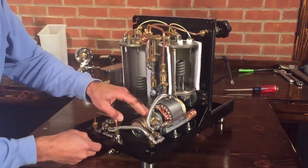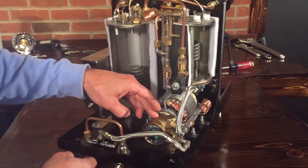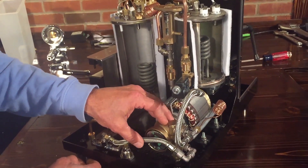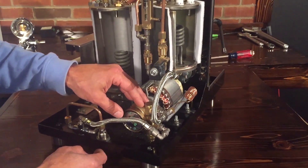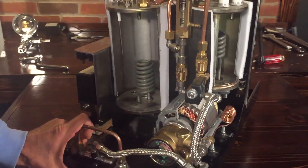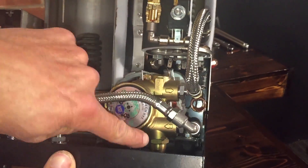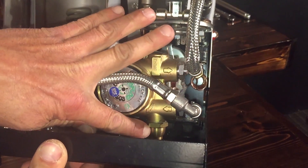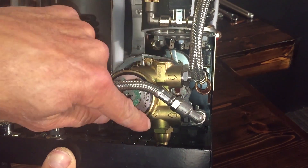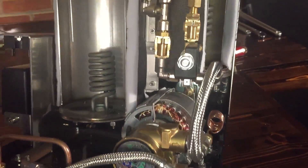You appreciate the inside of this machine, and you've seen just about every machine that's been made. The water comes out of that side. When you adjust the pump pressure, it adjusts the spring in there. If you want to lower the pressure, you can loosen this — it bypasses water around so only a set amount will come out.